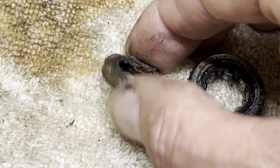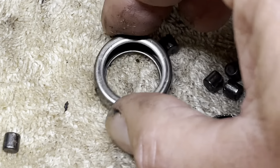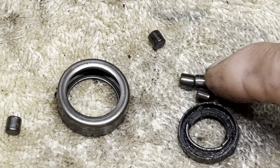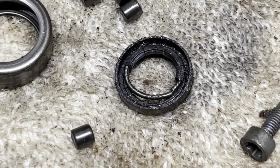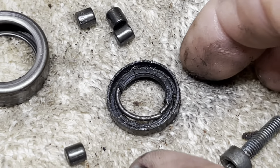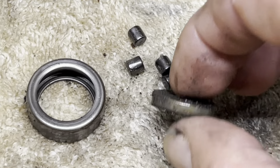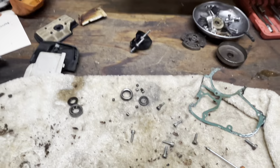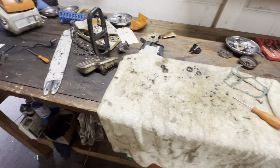Here's a seal from that side — even as nasty as it is, that doesn't look too bad. That's from the flywheel side. And then over here there's your outer race, there's your roller bearings. If you look — you can really see the cracks in there. This is on the clutch side. That side's obviously going to get a little bit more heat, since the exhaust is over there from the muffler.